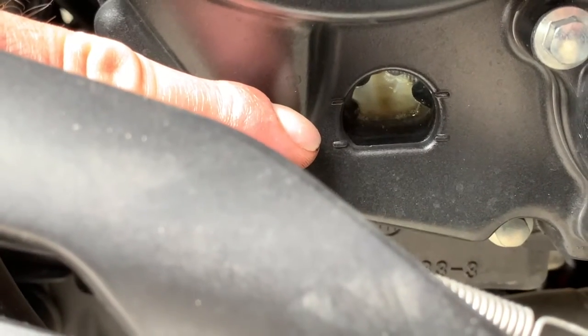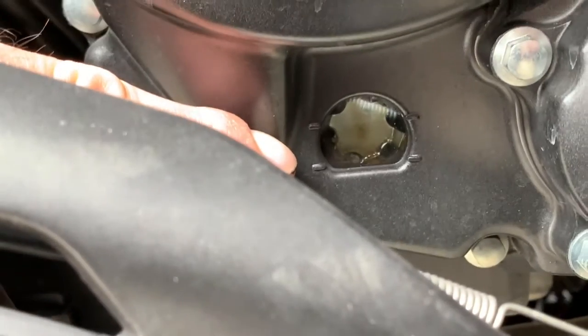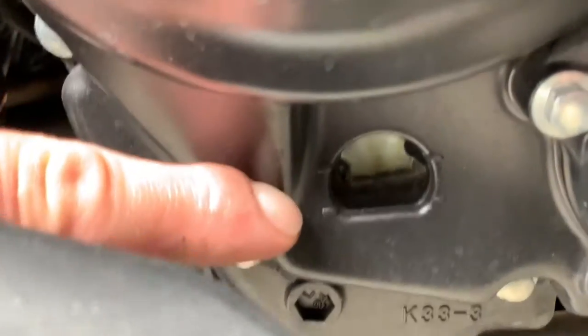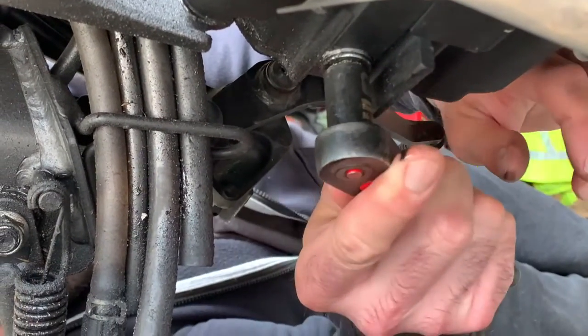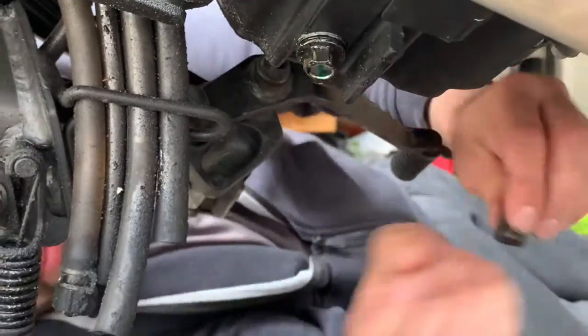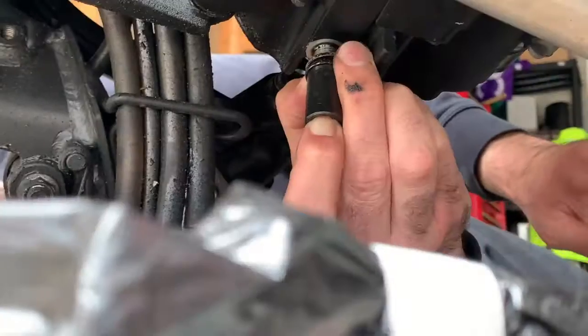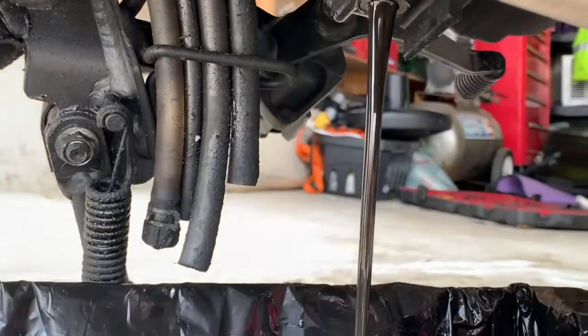While sitting upright on the Honda Rebel, the level should fall somewhere between these two lines, not too low and not too high. The reason you should always change your oil before you fire the engine up in the spring is because rust particles can flake off into the oil and scour bearings and other parts during operation, leading to wear. That's not how you treat your baby.